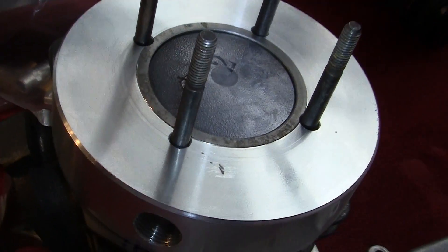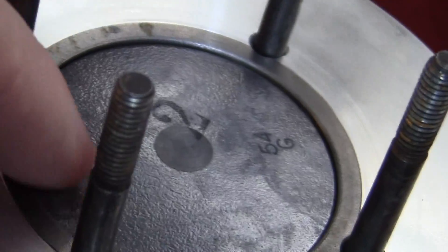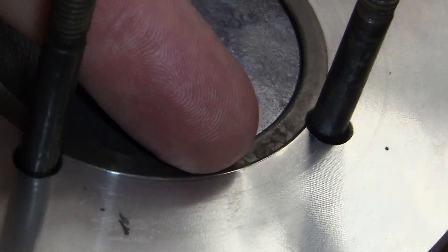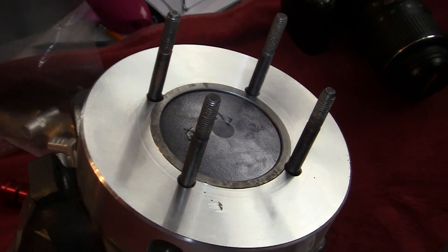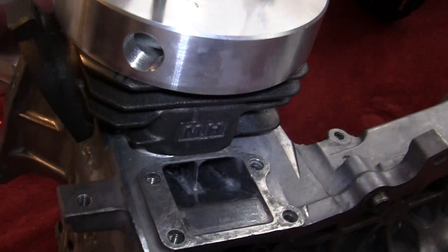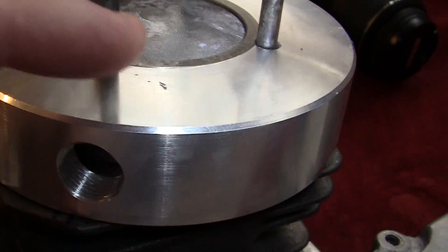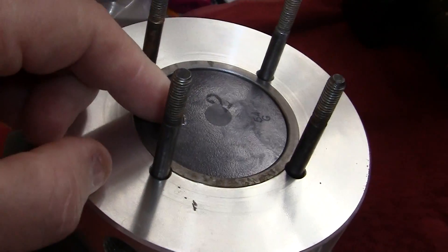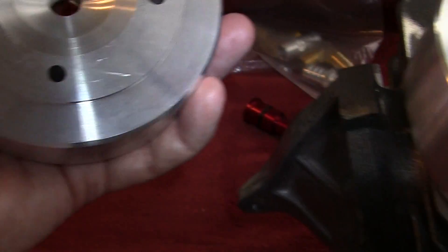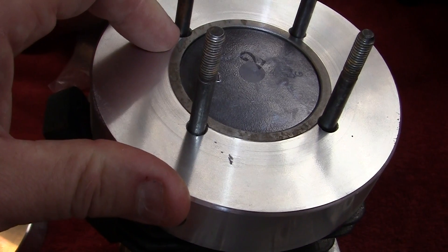This is your deck height right here. What I'm wondering about with this setup is the piston will usually come right to the top and not leave a little lip. This is a different type of cylinder — I've never quite seen it do it that way. I'll have to put a little gasket down in here, which will raise the cylinder higher and leave a little more gap. When it leaves more gap, your compression isn't as high — it doesn't give you the biggest bang.